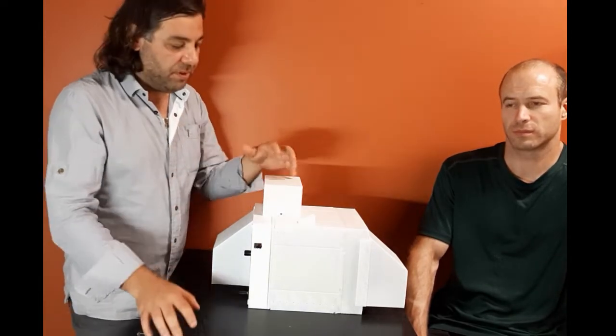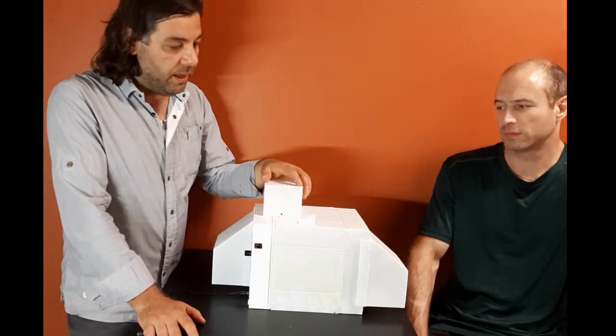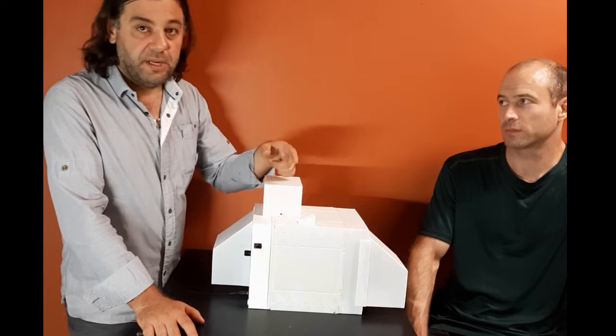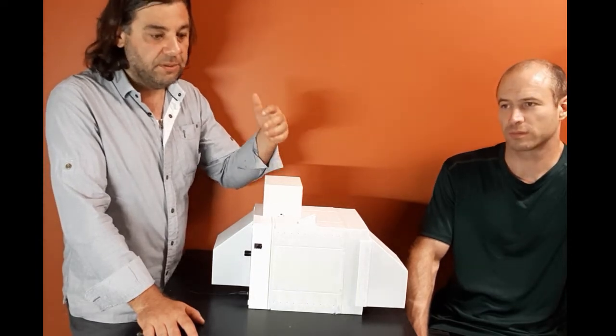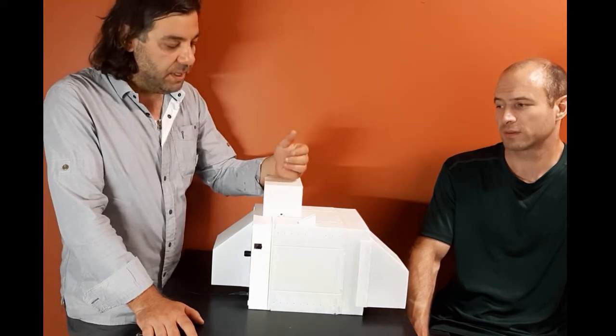If you want fresh air in that closed environment, you would have to open your ventilation, but that means your heat is going to go out, right? And so for that kind of small space where two people breathe the same air, with that humidity problem, we thought this could be a pretty neat solution, to replace just the ventilation that is already installed with this heat exchanger ventilator, right? So you keep your heat inside the truck, but you still have nice oxygenated air coming from outside, and you have close to 90% efficiency of heat transfer, right?